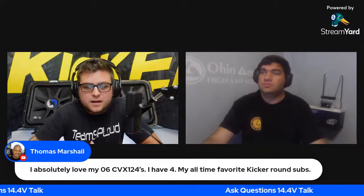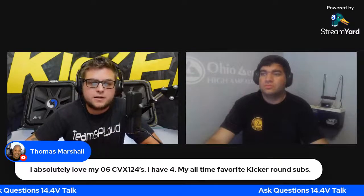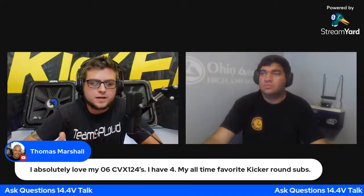They are. And whenever I first got my Solo X and I would talk to a few people that actually knew a thing or two about audio, they would always say, well, the Solo X is the biggest and it's the loudest, but the CVX in performance was better. Now, actually knowing what I'm talking about, kind of, the efficiency is around the same. I think the CVX is a little bit higher, dB at whatever, 3 feet. But if you look at the QES and the FS and everything else, I really don't see the big difference. They both are great drivers, but the CVX is almost like the Comp Q, but just back in the day. Pretty cool.